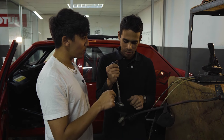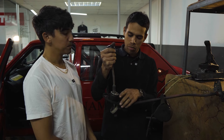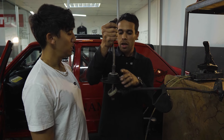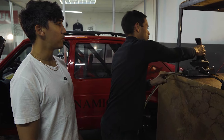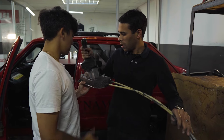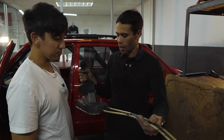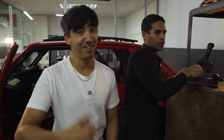Gear selectors — this is the old one. We removed the standard Mark 1 gearbox and fitted a 5-speed TDI cable shift gearbox. This is the standard selector rod, which rests onto the chassis and runs underneath the car — we don't need that anymore. We're now running a shift tower with shift cables from a Golf 5, so this runs inside the car. We close up the old hole, and it mounts on top going out into the engine. It's actually a lot more work, but we're getting it going.